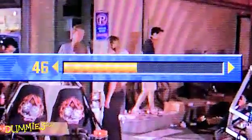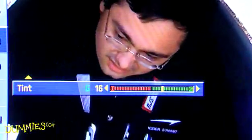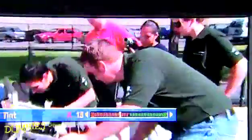You'll want to adjust your color too. Setting your color too low gives you black and white or gray images. Setting your colors too high makes the colors bleed together. Now adjust the tint — that's the amount of red or green in the image. Tint is pretty hard to adjust correctly, but here's a tip: adjust the tint to flesh tones. So if a person's face looks reddish and they look like they're about to explode, turn down the red. Using a preset can make this adjustment easier.